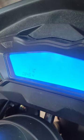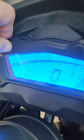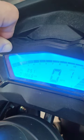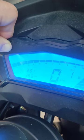Maybe it is how many impulses this front wheel have to put on the sensor to make 1 kilometer up or down, actually 1 mile per hour up and down. Hopefully you're getting what I mean. So if the wheel make one rotation, this will be just one impulse, and there will have to be two impulses to give to this cluster to make speed up or down. So then this cluster will show you this updated speed.